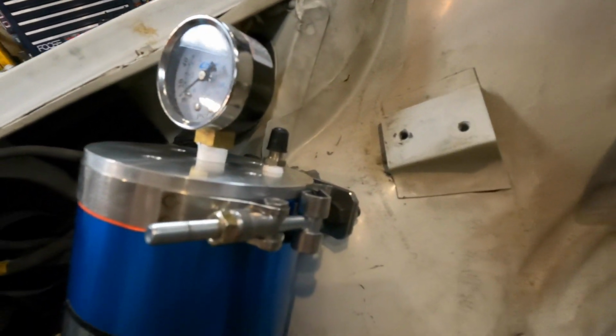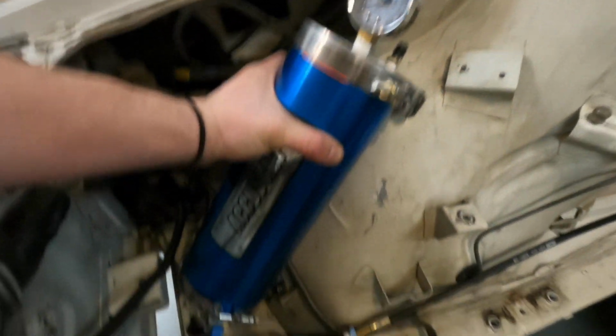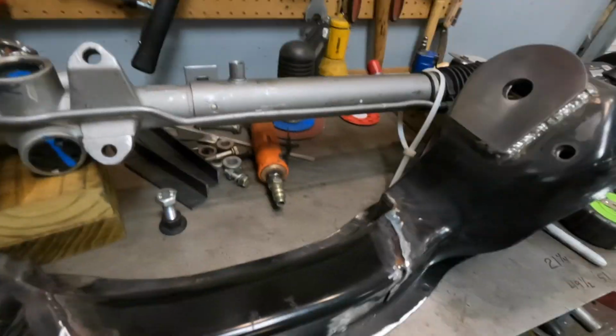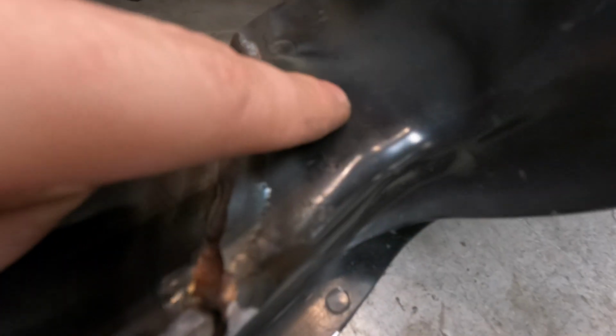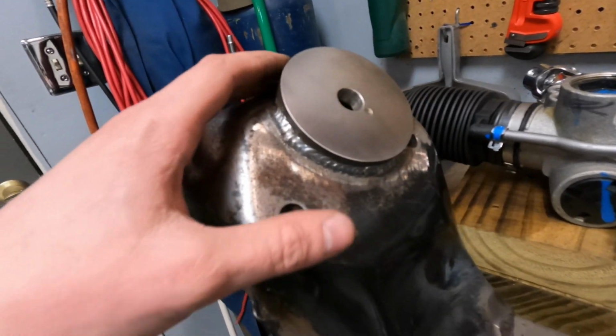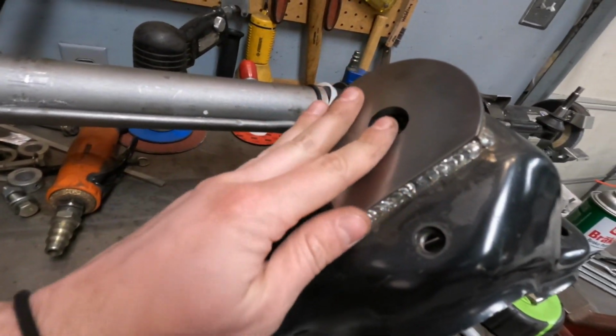Check it out, guys. Top mount is done. I'm gonna put a little stud through there and then a little bracket. She ain't moving. What we've been doing, the Elder Guru has been getting stuff done during the weeknights. He's gone through and he started welding up these seams because this thing's just spot welded together in a couple of places. So he's going through and making it a little bit stronger. He finished boxing all of this stuff in for the oil pan clearance that we did. He even went back and where he had hit with the grinder, he filled them in with weld and then ground them back down. So he called it hackery, and I was like, dude, for the stuff that you're doing, that's not hackery at all.